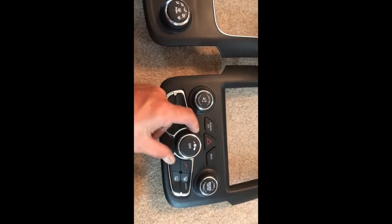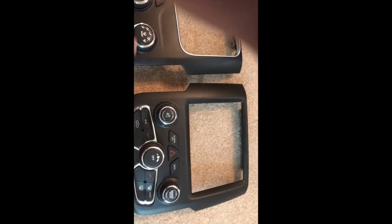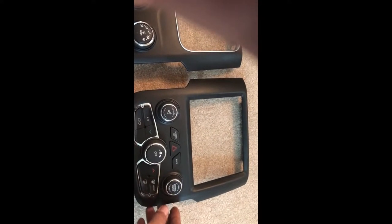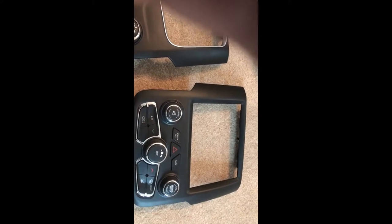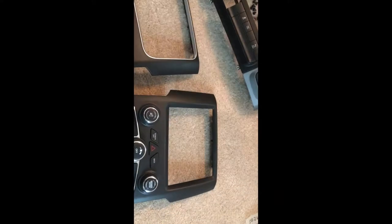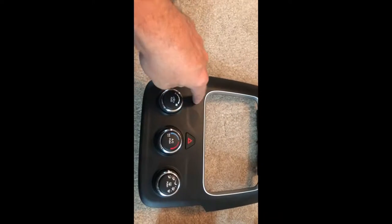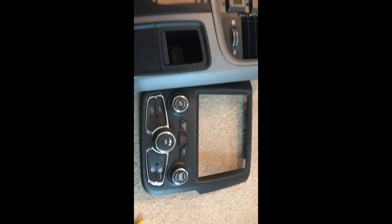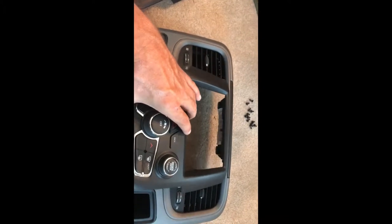There's the old bezel out and the new bezel — the new one has knobs for the radio as well as seven-speed fan control; the old one was four-speed. If you get this from Infotainment, they do a four-speed bezel and put a volume knob right there, but it looks really cheap. 4th Gen RAM Electronics rewires everything with a conversion module to switch to the seven-speed fan control and wiring harnesses, giving you a more factory look.